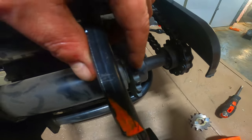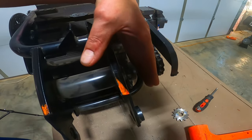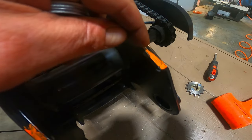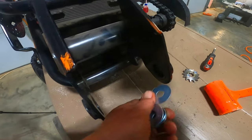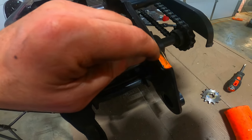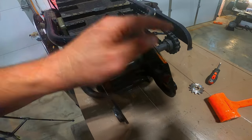And also, the sprocket on the jack shaft here is a little bit too far out, so it doesn't quite line up with the sprocket on the engine. So let's see here. I've got a few washers. What I'll end up doing once I clearance this out, I'll probably stack a handful of washers on this side, maybe just one on this side, so I kick the whole ski over about, oh, 3/8 of an inch, not 3/8, about a 1/4 inch, and hopefully the sprocket will line up then. Well, let's go grab the cutoff wheel.